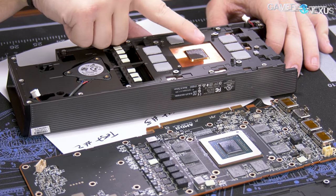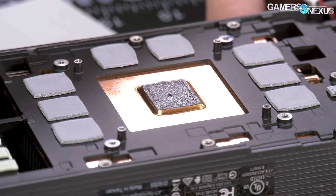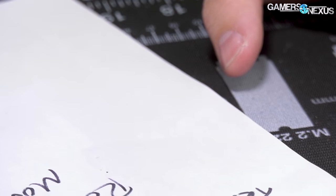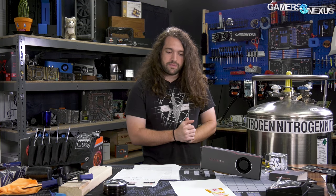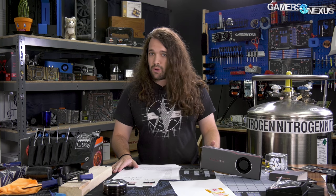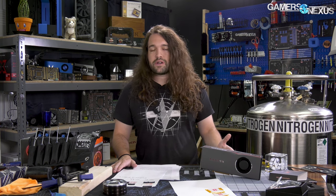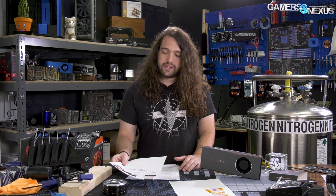There are some ups and downs to this. The positive side is that thermal pads, like the Hitachi pad or like some of the other more permanent thermal pads in the market, like Carbonaut, the advantage to them is that they age well and they don't really age like thermal paste. A lot of paste will cure over time and become worse over time. The downside is that all of these solutions, including Carbonaut, are not as thermally effective as a good thermal paste. Much of this comes down to the properties of the material, but also the thickness of the material. With thermal paste you can smash it down tighter, and that Hitachi HM03 pad is pretty damn thick, so that does impact the cooling capabilities in a negative way.